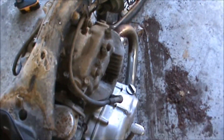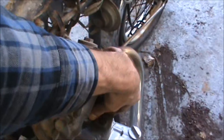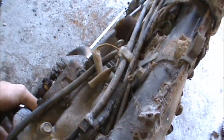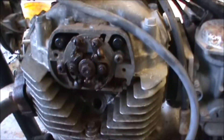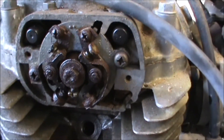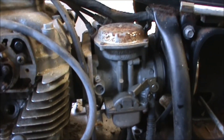Got this plug out, put my finger over the hole and kicked it over — good compression. The cylinder was full of water; I cleaned it out best I could. Sounds like it's got pretty good compression left. The points weren't moving at all — it's dual points — so I got a new set ordered to throw on there. Need to get my key for it, then pull these carburetors off and see if I can get it started.